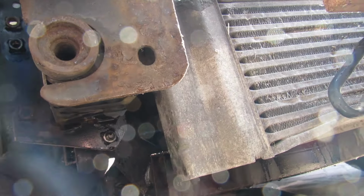So in the next bit, we'll be showing you with the pump off. So that's that pulley on the top right removed, and John's just going to try and remove the water pump and see how easy that is. So I've got a pry bar, and I'm just going to try and lever it off. We'll have a little bit of water, so if we've got a thing underneath. Move the thing over a bit. It's just a gasket. Just making sure. There's another one there, a little tiny Torx. Didn't even see that one. It's a small one.